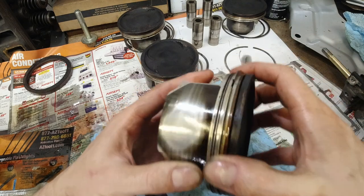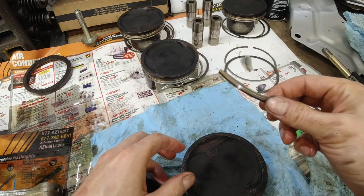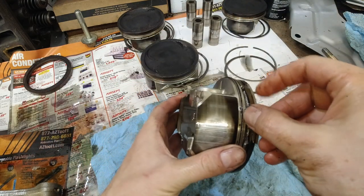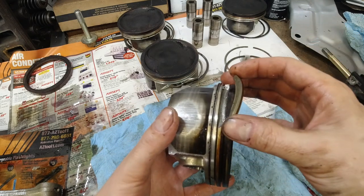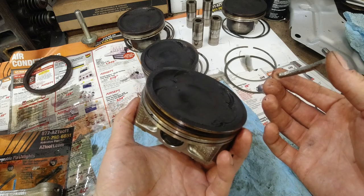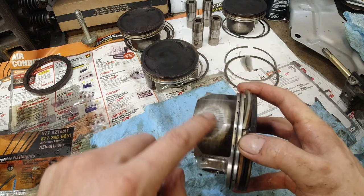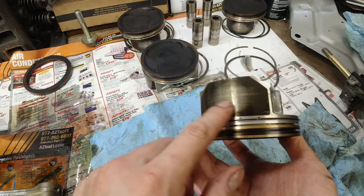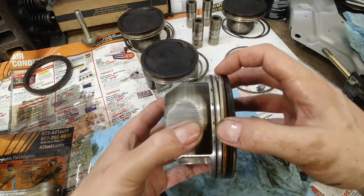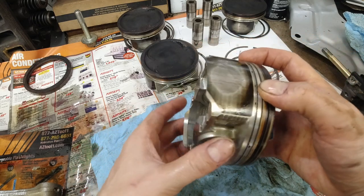of the bunch. Huh, I already see the problem. I'll show you in a second. Oh, look at this. Would you look at this? Check this out. What do you say to this, Subaru? Oh, man. And this is the scuffing on the cylinder wall. This was actually on the upper side of the wall, the top side, so it was going like this. Lucky number four.